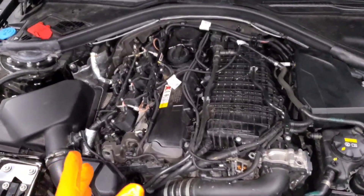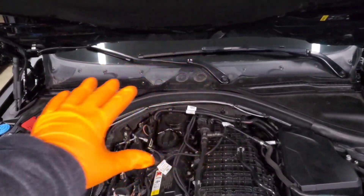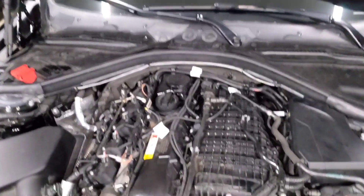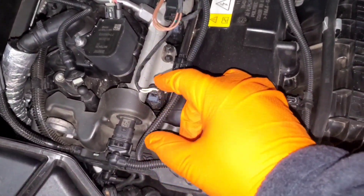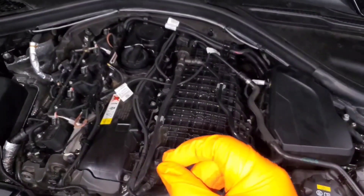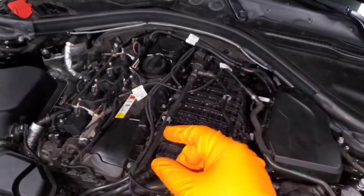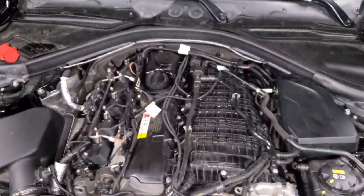Then eventually we upgraded to electronic fuel injection, like what pretty much all cars are today. You have an electronic fuel pump back in the tank — it's nice and quiet, controlled by the engine control unit, and it basically controls how much fuel it flows. Up in the engine bay, you have electronic fuel injectors mounted in the intake manifold, one in front of each cylinder. Whenever the DME told it to, it would open up that injector, release some fuel, then shut it back off. So instead of a wide open nozzle constantly spraying fuel, you're only firing fuel into each cylinder as needed — much more efficient, easier to control and tune.